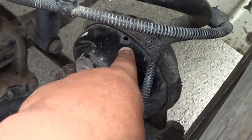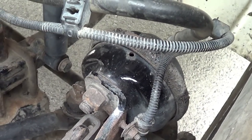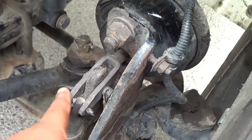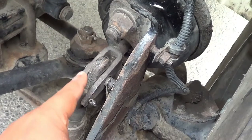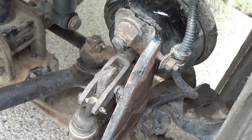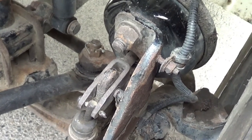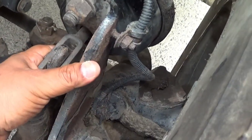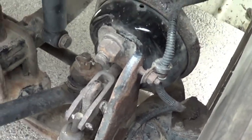This right here is my brake chamber clamp, my brake chamber, and my brake chamber clamp. I'm going to make sure there's no crack or broken, and they're securely mounted, no missing hardware, and they're not leaking. My push rod and my slack adjuster — I'm going to make sure they're not cracked or broken, securely mounted, no missing hardware. They're securely mounted by two pins and two cotter pins. If I pull on it, it should be no more than one inch of play when my brakes are released.